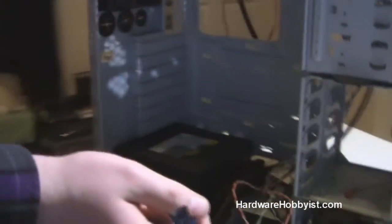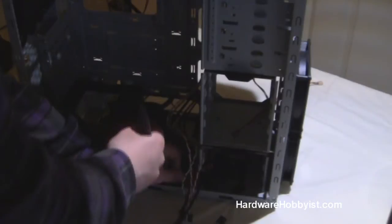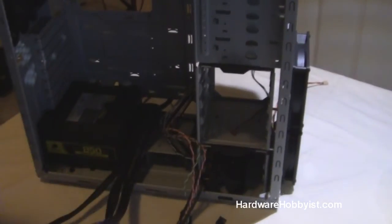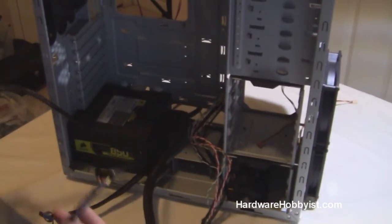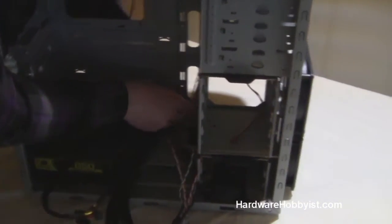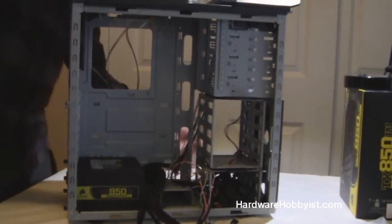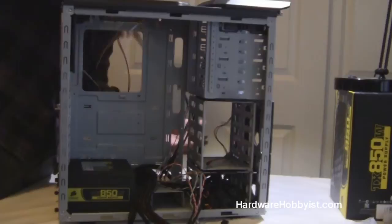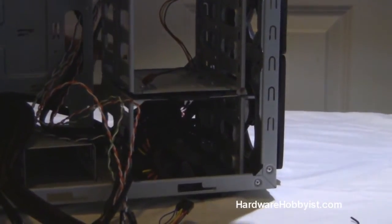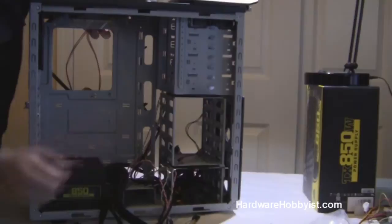As for the 24-pin connector, because this one's so big and they're usually not the longest of cables, it's pretty good just to stick it down here and maybe thread it along the bottom of the case and then up and over, just so it's sort of out of the way. You just don't want cables hanging in mid-air like that — it doesn't look so good, especially if you have a window. Let's see the SATA cable right here — I'm just going to stick this out through this cutout. Then that'll make it really easy to have access to the drives. We're probably going to need this excess actually because one of our DVD drives is going to be up here and the other hard drive is going to be here, so we want it to stretch.